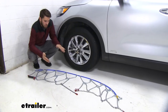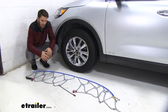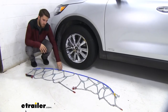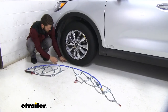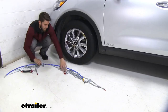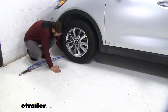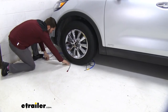The first thing you want to do is lay out your chains and look them over — make sure there are no kinks or twists in your links, and if there are any broken links, try to fix those first. Once your chains are good to go, slide it behind your tire. There's a gap that's going to be the halfway point: one side will sit under the tire and the other side will sit on the opposite side. Slide the cable with the chain behind the tire and pull it out the other side, lining it up as you go.